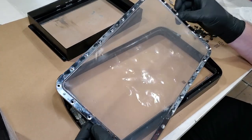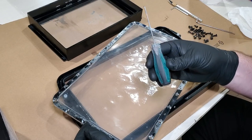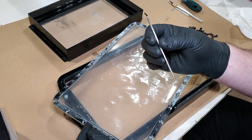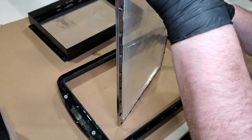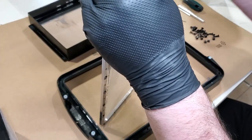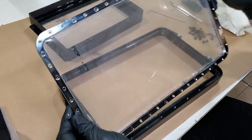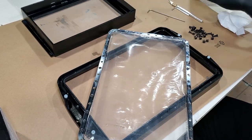That's a lot of screws. If you have a power tool for that specific size, use it — it will make your life much easier. I couldn't find mine, so I had to use what came with the printer. Now we're going to clean this off all the way around, getting any excess resin off so we don't contaminate the new FEP. Flip this over and there are a billion more screws — I'm going to lay it flat and take those off now.